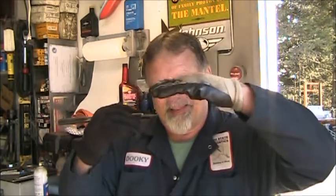That's just this engine. They'll never run as smooth as, say, a three-cylinder 70 horsepower that has a carburetor per cylinder. If those are all linked in sync, each cylinder has its own reed, its own carb, they'll just run a lot smoother. When you start what I call reed sharing on these twin cylinder single carbs, there's no way to regulate that fuel oil mixture into the cylinders perfectly, the same exact amount at the same time from top and bottom. It's just the nature of the design. The Yamaha Enduros run kind of the same. They're a little bit shaky and loud at idle, but then they really buzz when you crank them up and start pouring the fuel into the cylinders. But these are good, tough motors.